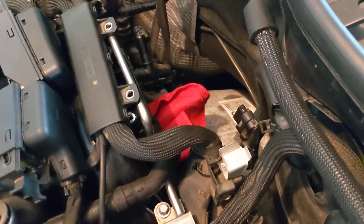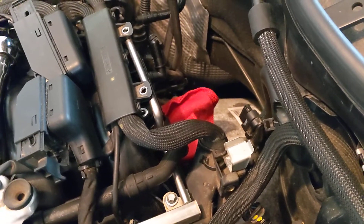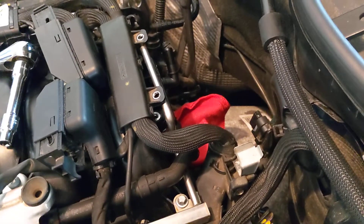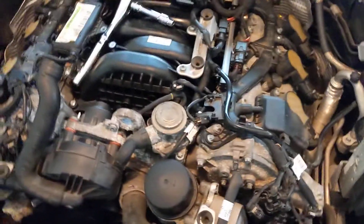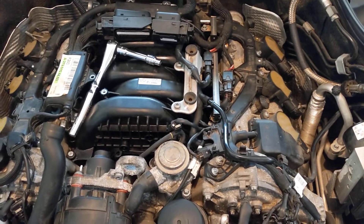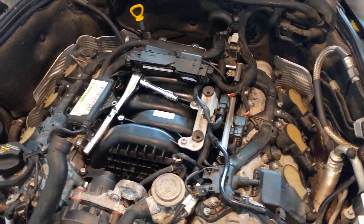You're going to need the 82mm throttle body — just go for a Bosch piece or a VDO if you can find it. Going genuine is going to be like $1,300. Going VDO or Bosch will be around $300 or $400 depending on where you look. It's a pretty important part of the car, so I wouldn't cheap out on eBay no-name parts. You should also make sure you order the CLK 550 throttle body neck, or mass air neck — that rubber boot I showed earlier. That has a different diameter than the stock one because it's accommodating the larger throttle body, so you're going to need both of those. If you're buying brand new genuine, it's probably going to be around $450–$500 for the throttle body and the boot. If you can find a used boot, like I did, it's like $20 — just make sure you clean it up and make sure it's not disintegrating, because you don't want rubber going down in there.